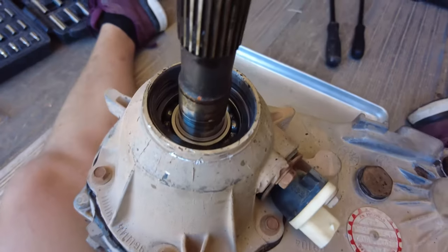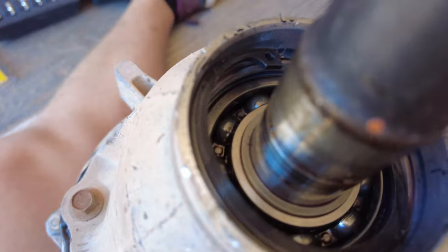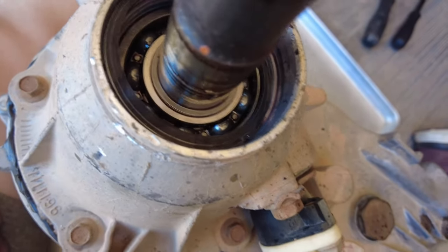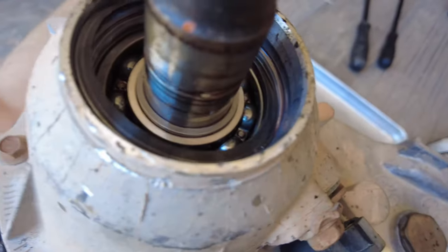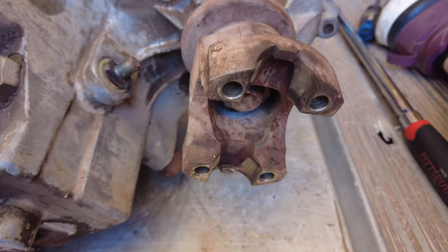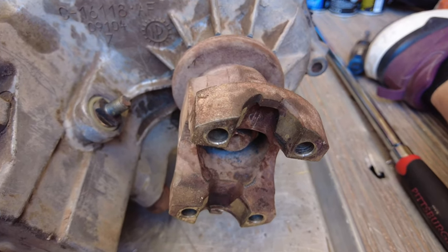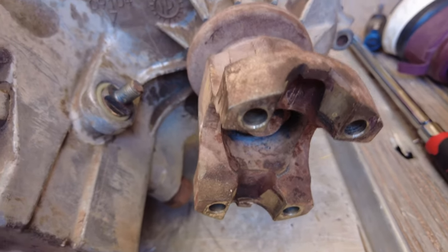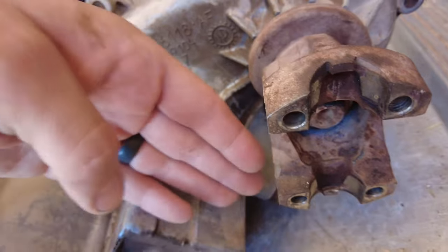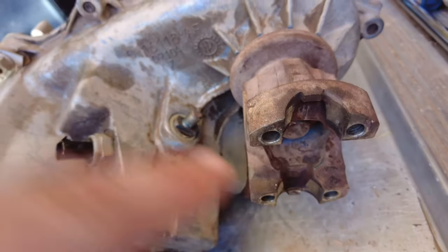After you get the oil seal out, you're going to have your second large snap ring. I'm slowly getting it out of the channel, but it's at the point where it's going to shoot out like a rocket, so I'm putting a rag over it to help catch it so I don't get smashed in the face or it flies off and breaks something. If you haven't done any work to your transfer case and this is the original setup and the yoke's never been removed, take your longest Harbor Freight breaker bar and an inch-and-an-eighth socket — cover it with PB Blaster or get it as hot as possible with a blow torch. Jam your block of wood against the edge of the yoke and the T-case to hold it in place while you loosen that nut.